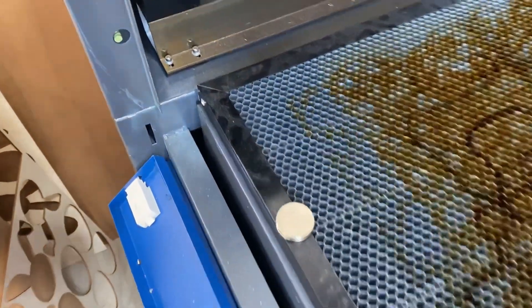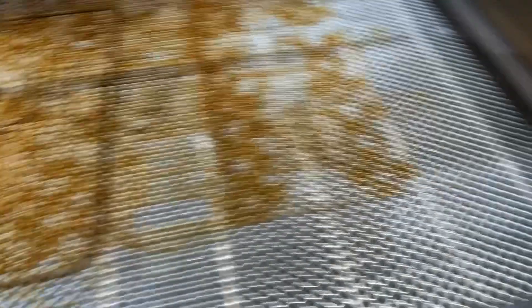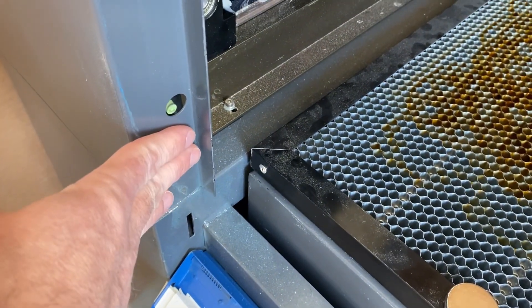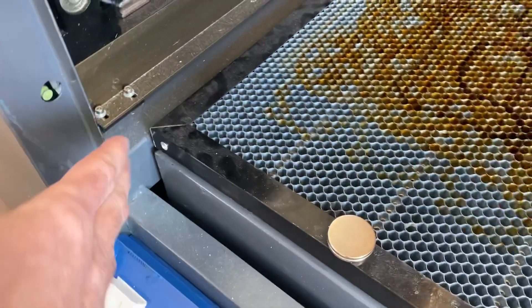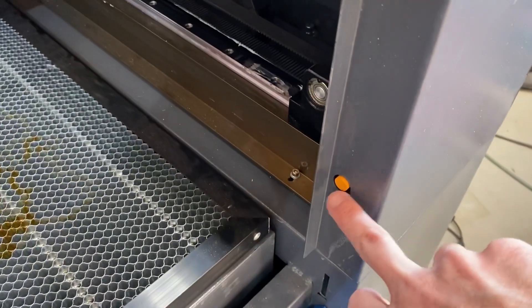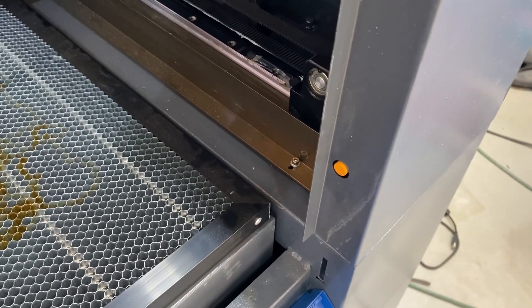Getting up close to the machine, we can see here in the doorway there are two of these sensors. Both of these sensors detect metal, so basically they're looking for the lid to close down and the metal to be close enough to the sensor. This one actually controls the loud alarm that's super annoying, and then this one is integrated into the controller and controls the machine protect — and that one you can actually just turn off. Let's take a look at them a bit closer.